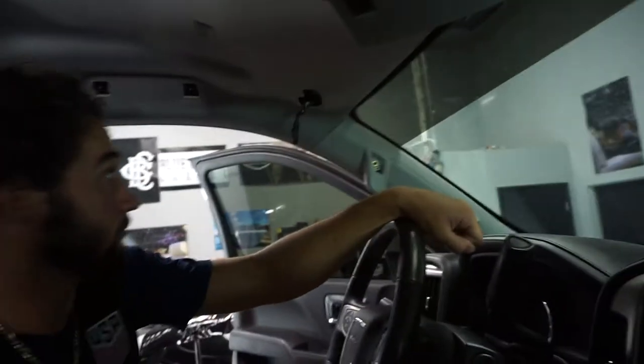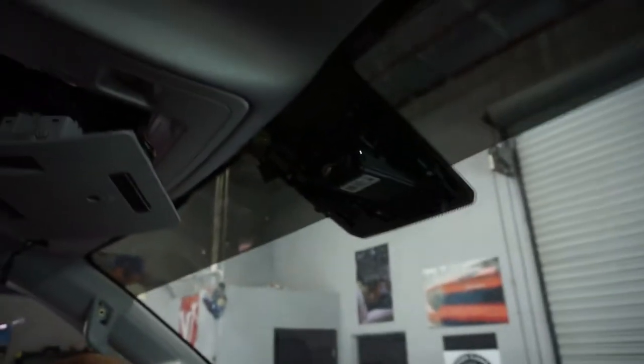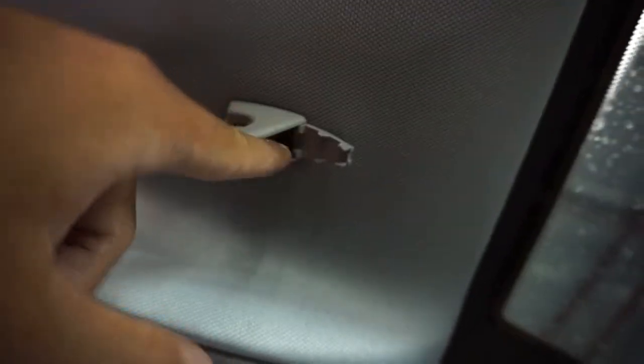Those back tabs — there's two on each side. When you take them out, be very careful because if they fall, they fall all the way down to basically the floorboard and you'll have a great time fishing those out. Then you take the mirror off — that's pretty easy. You take off the plastic cover, there's one star-head screw that holds it up. There's another star-head on each side for the visor. Take those off and the headliner is basically off.